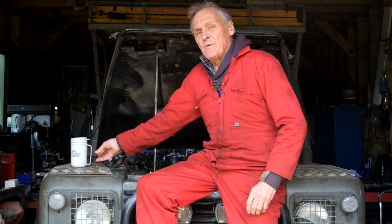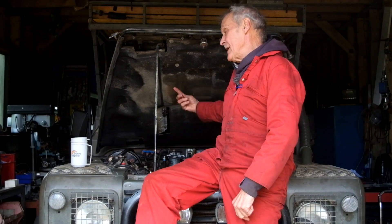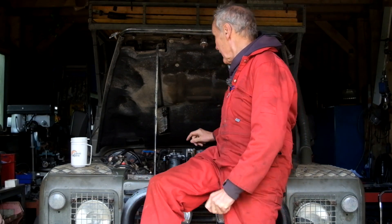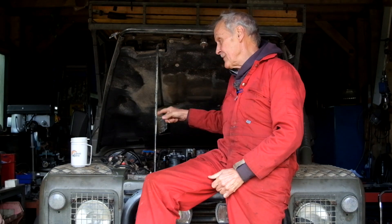Let me explain. With the main electrical system, we've got circuits which are generally either within the engine bay or just on the other side of the bulkhead in the front of the cab, and the power requirements are quite low — the biggest user is the main cooling fan at about 20 amps. A good solution is to have a wiring hub mounted on the front of the bulkhead covering all of these circuits. By contrast, the auxiliary system is much more widespread, going from the front of the vehicle to the rear, inside and out, and we've also got some significant power users including the compressor and the inverter. So the approaches to the two are going to be rather different, and I'll show you the thinking behind this in the next section.